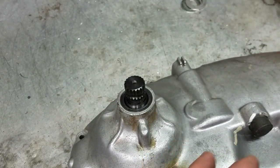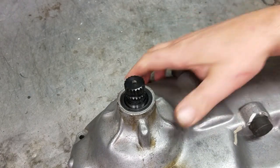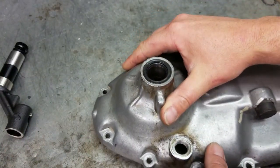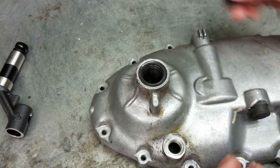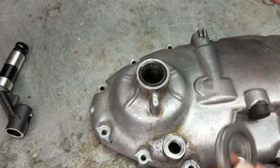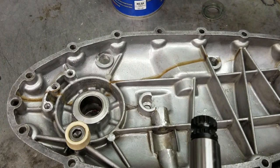And there are a variety of shims out there in different widths, and I have an assortment from MB and SIL that I use. I like having an assortment on hand like that, because the SIL ones are just a little imprecise. Sometimes I can get away with just one shim, but if I need a combination of shims, the SIL shims are extremely handy, because I can usually make what I need to happen using those. And now we're gonna go actually fit the kickstart.